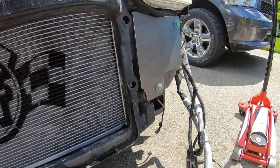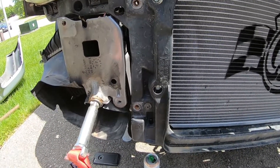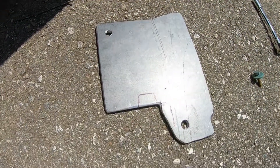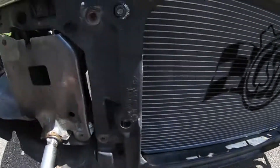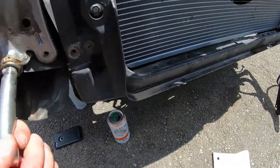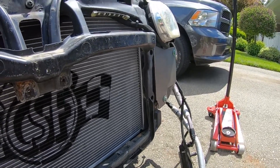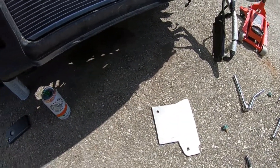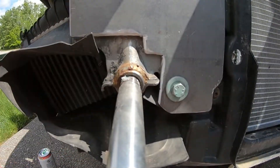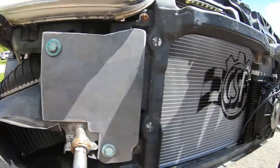One plate is literally perfect, everything fits on there good. The other one - when I was tracing I was tracing from the underside of the stock rebar and I forgot to account for the tow hook. So I'm going to have to go in the back there with the grinder and do notches so it fits over the tow hook. Other than that it should be okay. The first one fits in there perfectly with the 13 mils, nice and flush, nice and tight, no issues, with good clearance still. Let's get grinding on that, smooth it all over - fits in there really nicely now.